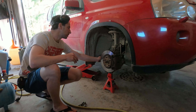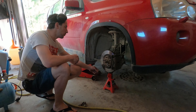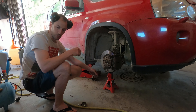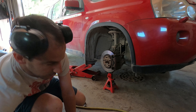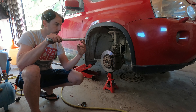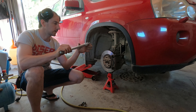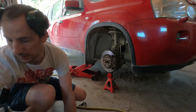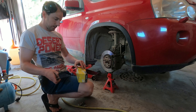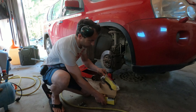Sometimes the cone shape of the tie-rod end ball joint makes it hard to remove. For that there exist a couple of solutions. Today we'll try to use a tool — this kind of fork — and we'll slide it on top of the ball and then hammer it. That normally works really well. This here is the new part, so that's how it looks.